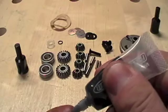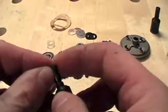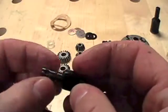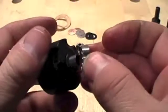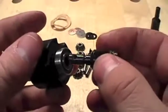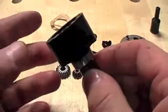A little more grease. Lubricate the second O-ring a little bit. Alright. Roll it down onto the outdrive shaft so we can see it going on, down into the groove. Now that those O-rings are on, take our housing. We're going to install a bearing on one end, like so, and then we're going to feed an outdrive in. It takes a little effort to get it in. You don't want to be too rough with it because you don't want to damage the O-ring.